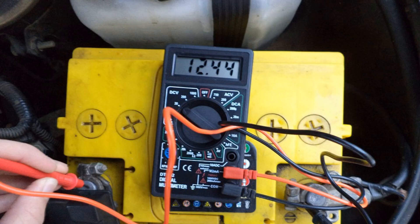What are the differences of maintenance-free batteries? First, let's define this design to understand what a maintenance-free battery means. A maintenance-free battery is a battery that does not have a direct path to the banks and plates. Often, the battery is either a calcium battery or a hybrid battery. Now we can safely list its differences from its predecessors. It has an impermeable casing — consequently, it is impossible to open it, and you can only charge it.